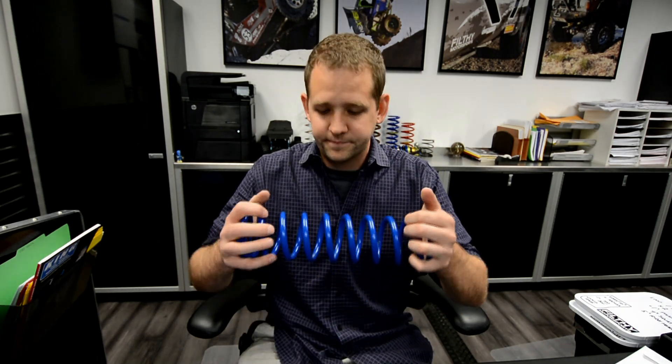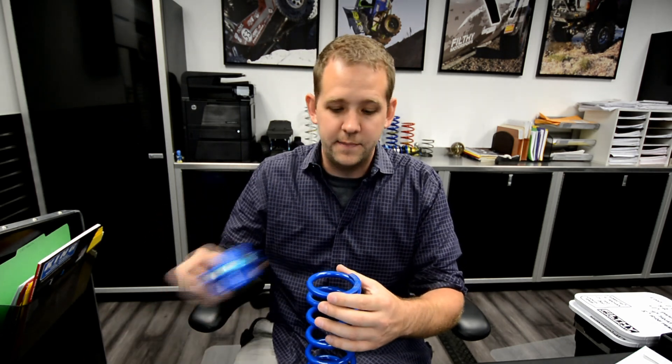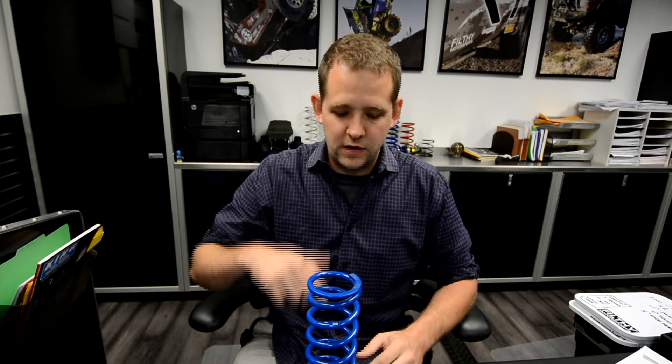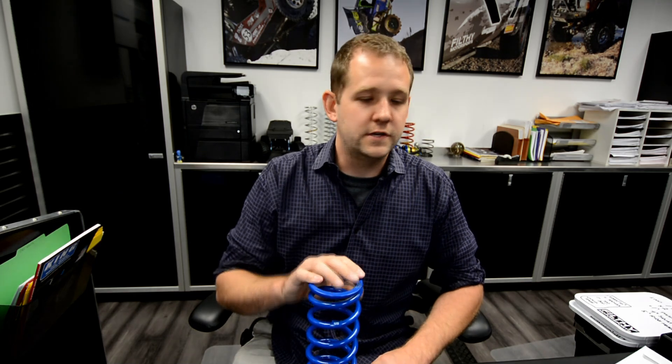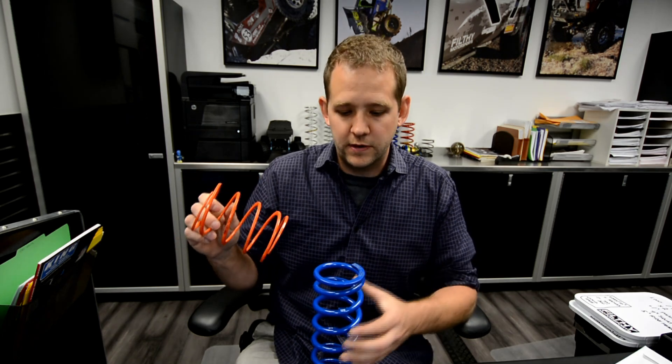If you watch the video a couple of times and go through it, we've also got all of these instructions posted on Crawlpedia to walk you through it. One thing to keep in mind: you never want your lower spring, especially on a 14 or 16 inch 2.0 coilover, to be lighter than 150 pounds. This 125 pound spring — under the weight of the vehicle it'll bend. If you've got two of these springs lined up incorrectly against each other, pushing on the slider in opposite directions, it creates an S shape and you'll be scraping the bottom of the shock and the stop nuts. You can't buy a better brand of spring to avoid that — they will all do it. So try to keep your lower spring in the 150 to 200 pound range. If your numbers work out to less than that, you'll need to add a tender spring to make your springs heavier and reduce rubbing.